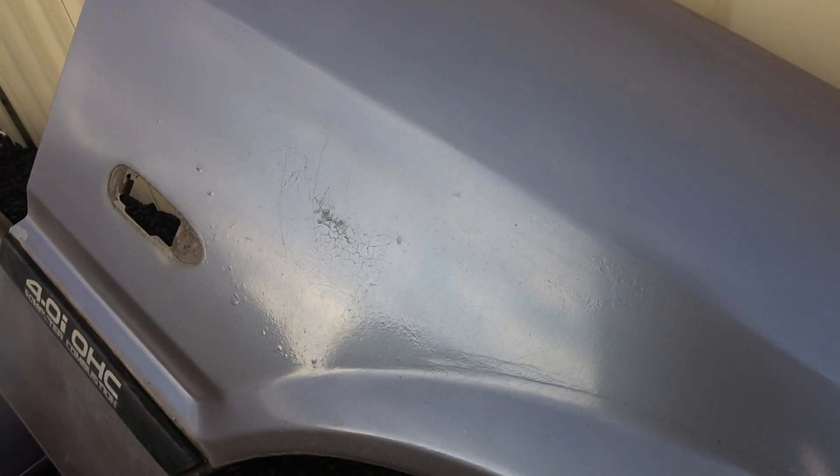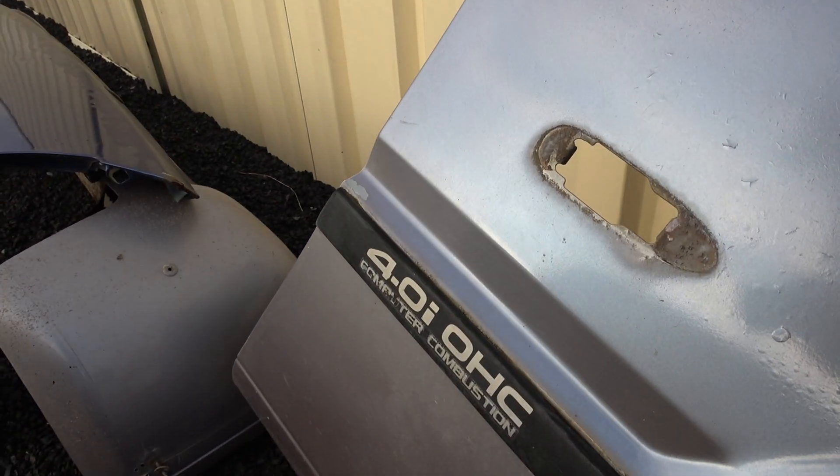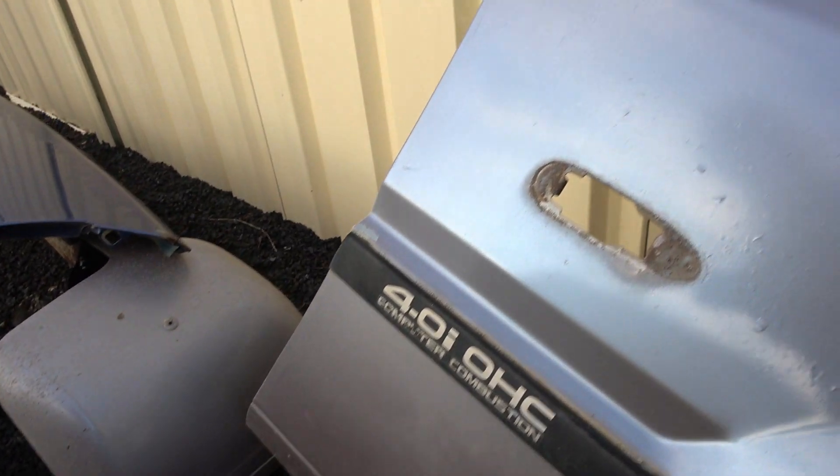The other guard here has been heat affected - you might just be able to see it, though we've got pretty poor lighting. The paint has crazed through here, and there's some more of it going on up there. Same as the driver's door - this is the driver's side guard and the whole guard is going to have to come down to bare metal, so it's going to take quite a bit more work. I do have all the clips to bolt it on though. It's had some previous work done on it - kind of like nail polish - and it's not happy with the paint, so I'll bring it completely down to bare metal and give it a fresh start.